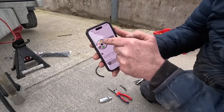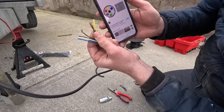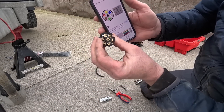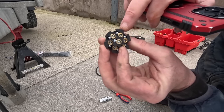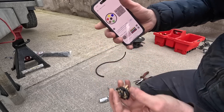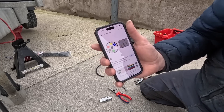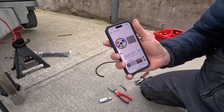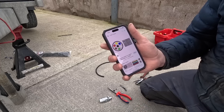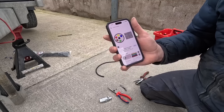Look at the diagram — you'll see your numbers with your colors. Your colors will match your wires. On the plug you'll see one, two, three, four, five, and so on. So you can't really go wrong — I wouldn't ever be worried about wiring a seven-pin plug. Just always check when you plug it in that it's working with the same connection you have on your Jeep, because some of them are wired differently. So always check it out before.